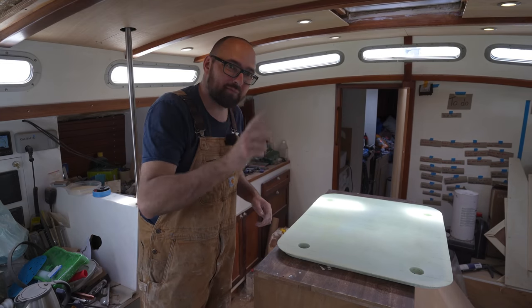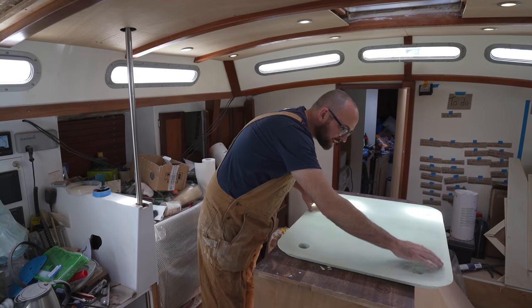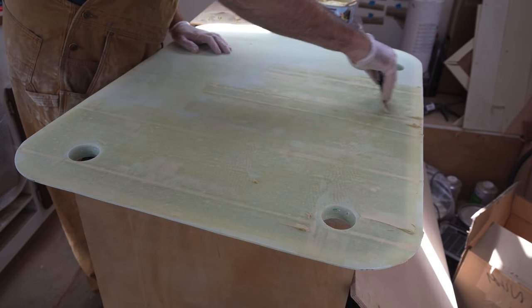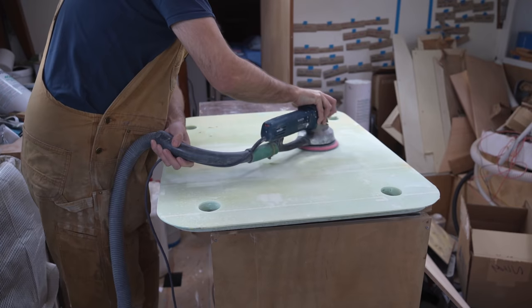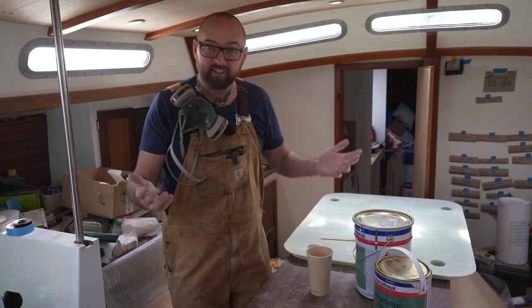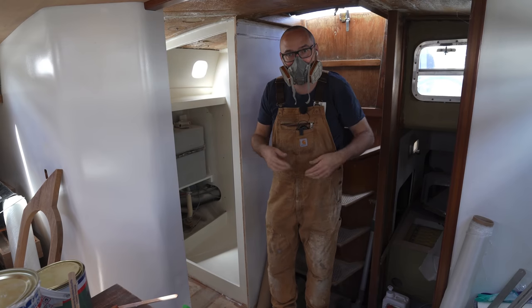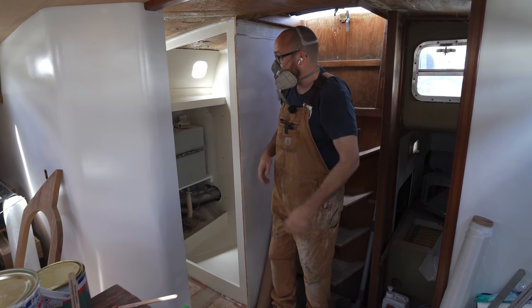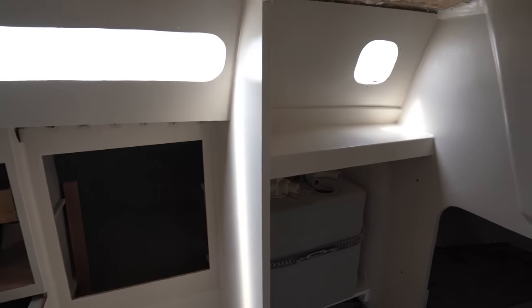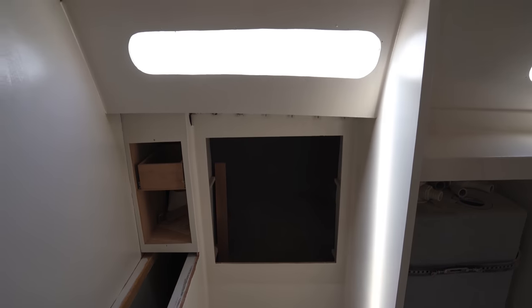For this round of sanding I'll use 120 grit, but for the final sanding in between the last coat of primer and the first coat of paint I'll use 320 grit. In my eagerness to apply the first coat of primer I completely forgot about the hatch — I've given the front of it a light sanding and there are some places where I want to apply a little bit of polyester putty. The head is ready, the hatch is finally ready — let's get that second coat of primer applied. I didn't bother setting up a time lapse because it's white primer going on a white surface, but things are starting to look pretty good in here.